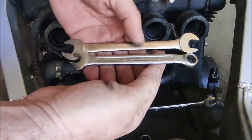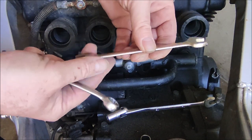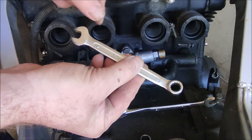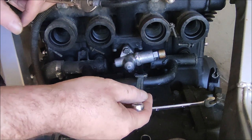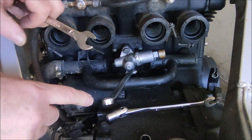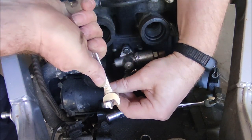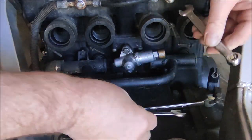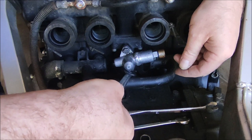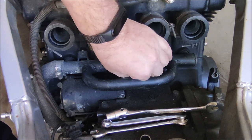So how do I do it? I pick a 10mm spanner with a ring on the end. I put this on the bolt head like this. Then I get a second spanner, put it in the ring, and I can really use leverage on it. Just give it a twist and there we go — I've now released that bolt. It's a bit of a fiddle because you need to keep taking it off and repositioning, but that is how I undo that bottom screw, and I do it up the same way.